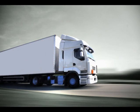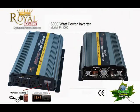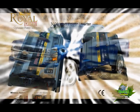Now, if you're going to use a power inverter in a small cabin semi-truck, you're going to want to get maybe a smaller type of inverter, maybe 1,500 watts to 3,000 watts, because you're just going to connect several devices. You might still connect a microwave or a coffee machine, but you probably won't be using several devices at once, and you also don't want to take up too much space within the cabin if it doesn't already have a designated compartment to put the inverter.